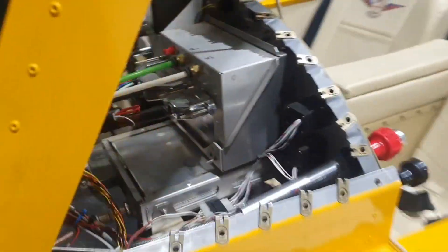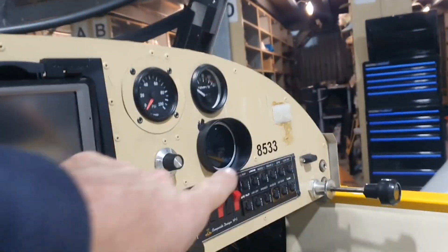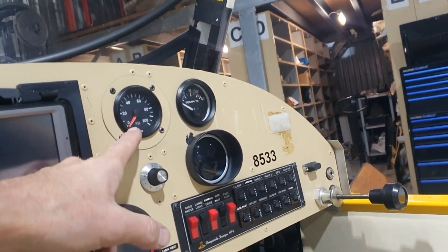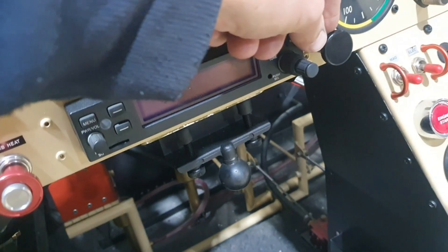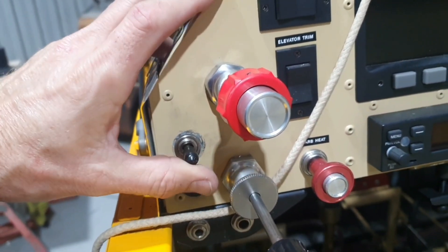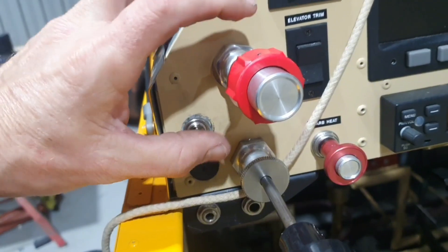In the cockpit you can see we've got our AFR gauge — I'll put a little placard on that — and we've got a coolant temperature gauge, so that's AFR, coolant, and oil pressure here. We've got our mixture control, throttle control, and I've reallocated the choke cable for a primer. I'll placard that as 'pull for prime'. The flap switch has been relocated there which should be quite convenient — you'll be able to operate the throttle and reach over and operate the flaps while on approach.